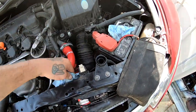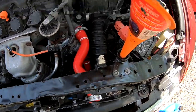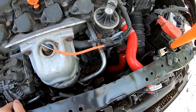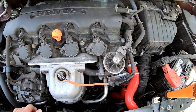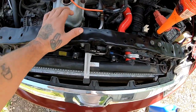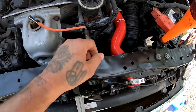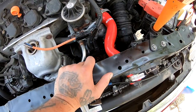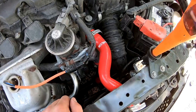I'm going to fill her up and see if I have any leaks coming out of these hoses. I went ahead and put fluid in and bled the system — there are no more bubbles coming out. Everything looks completely full. I got the heater going on inside to try to get all that fluid to circulate. I'm not going to put this cover back on — I'll leave it off for a few days just in case I need to get back into any of these hoses. So once again, this is the review on the R18 motor hoses — we will be doing an update in a few months to see how they're holding.